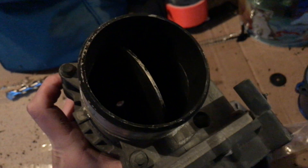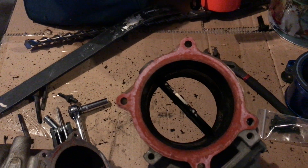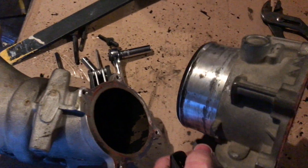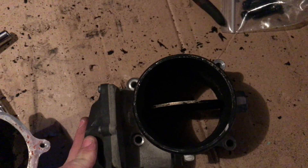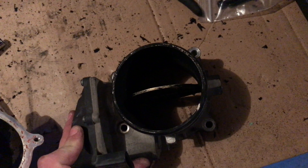There's one bolt here, one at the bottom, another one at the bottom, and then one on the top. Here's the throttle valve removed from the intake manifold. It was a pain to get off just because the gasket was almost glued to the intake manifold. The four holes are where the four bolts were that held it on, and I just had to use a hammer to tap it off. Now just put the delete on.